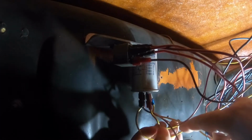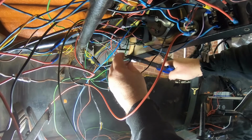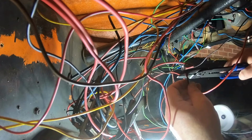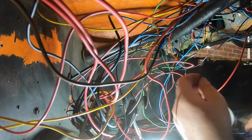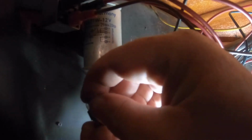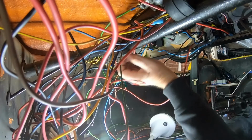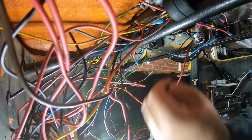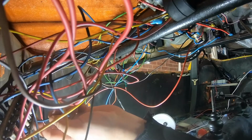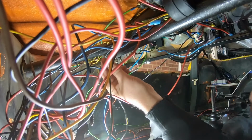You can see the abundance of yellow wires, which is making it really difficult to trace what's going on. Just working through and replacing everything that's on there as it is, before I know exactly what these different connectors are. Just going to put it back the way it was. I will replace the brown wire with some better suited color. So here we've got blue and red coming out of the steering column, which connects to blue, which runs through to the fuse box, which as you can see I've removed from the firewall, well, the bulkhead. I'm going to replace that with some new blue and red so I can trace the wire correctly.